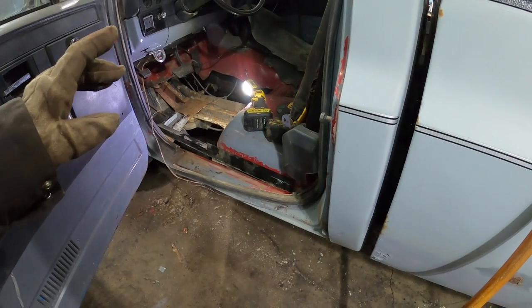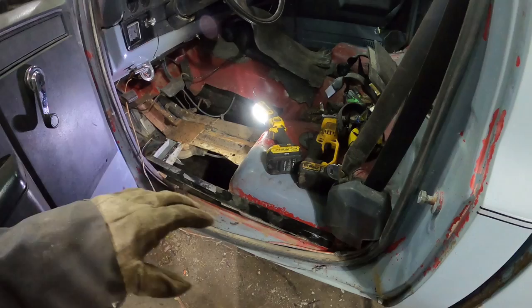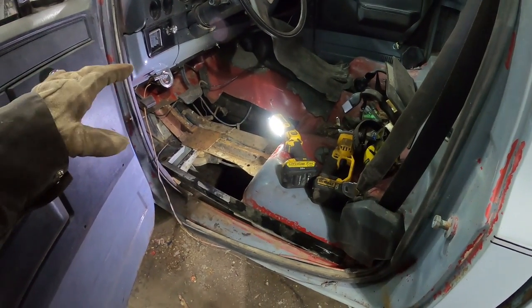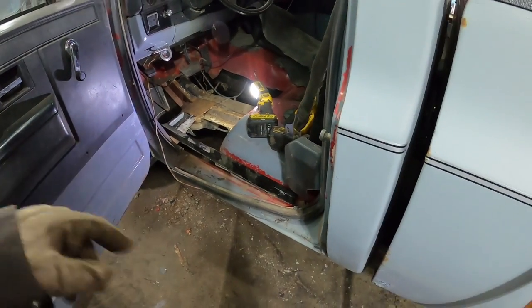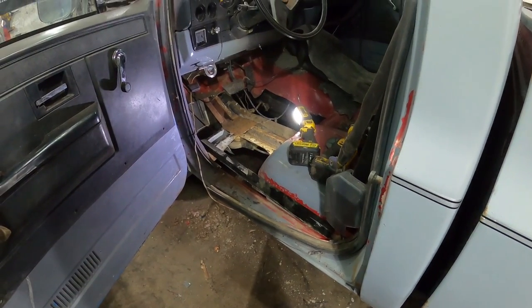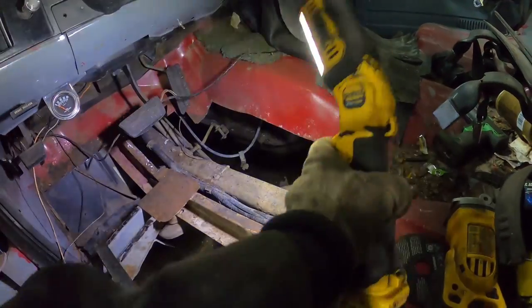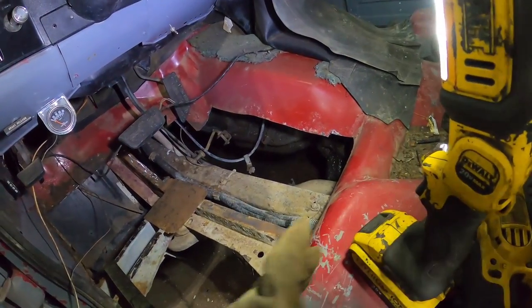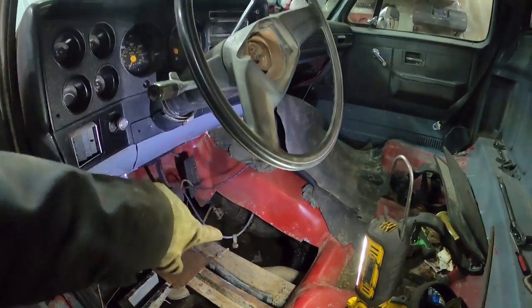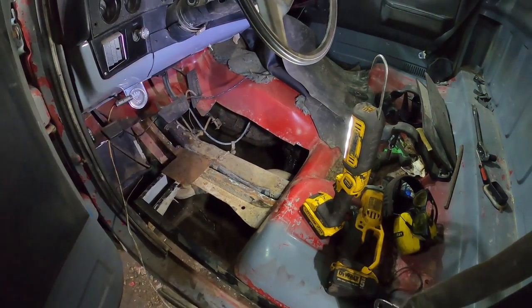That's where we're going to be. Going to do a little bit of cleanup so you can get some stuff tacked all together, give it some more strength and all that. And then I'll start fitting in that floor. I'll probably just get a few things tacked in and see if that floor fits. I just got a little bit more to trim around the gas pedal - I might have to actually drop the gas pedal to get in there, just to make a nice even cut. And then obviously clean everything up where I'm going to be welding.